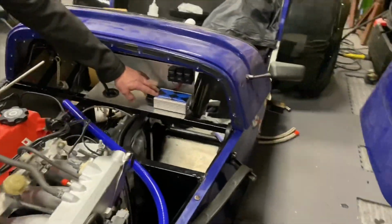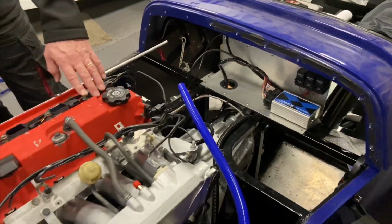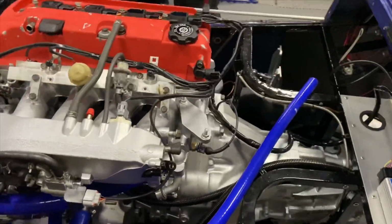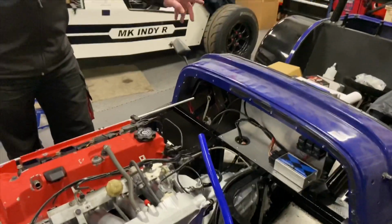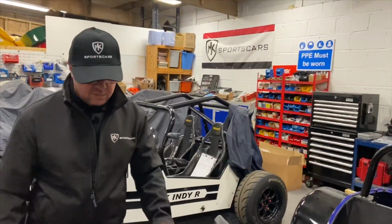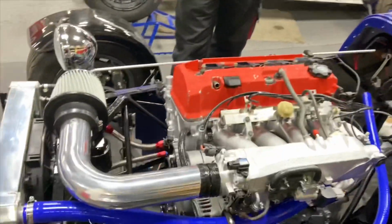So we've got the Omex 630 series ECU on this, with a plug and play wiring loom on that as well. We've modified, and most of the coolant pipes are in now. Engine earth straps have gone in. We made the bulkhead panel for it. So yeah, we're back on with a few other bits that we had to do for electrics. We've been sorting out the rear electrics, ready to come up as well. It's little bits and bobs on this. It's taking its time, I suppose.